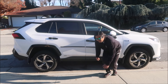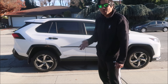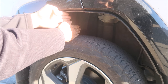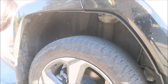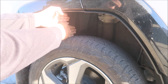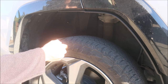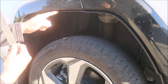I have the results from last time written down on the Eibach box, so we'll just add more notes to that. Here we go with the first measurement — this is the right rear. I've got my hand up there measuring finger widths, and then I'll put the tape measure flat with the tread and measure from the splash guard.